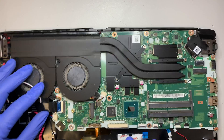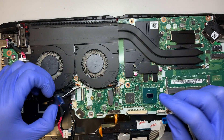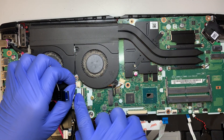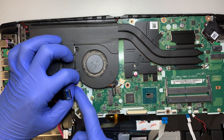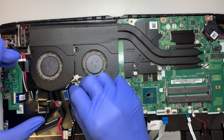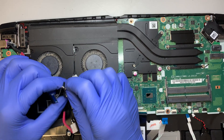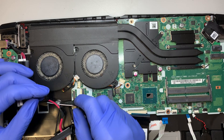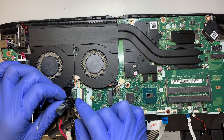So far we have that disconnected. This connector here is for your USB. This one here is for your fan — go ahead and disconnect that. And this is for the LCD screen — all you do is pull it right out. Actually, I'm sorry, this one is for the secondary hard drive — it comes right out like a Lego, just press in and pull to remove.